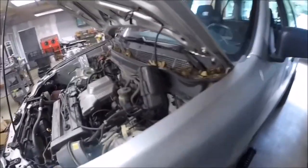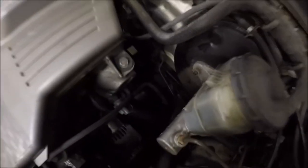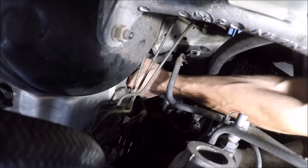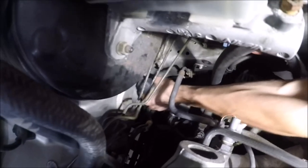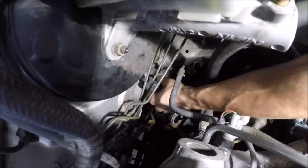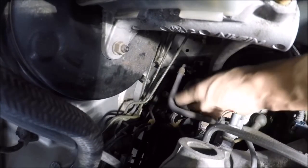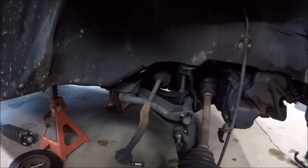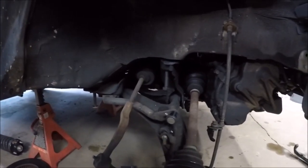Make sure your wheel is straight when you do that so it doesn't make your steering wheel crooked. I'm going to get the bolts out of the steering shaft and I have the steering wheel held with the seat belt so it doesn't spin and mess up your alignment. Now you're going to grab the steering shaft and really just wiggle it back and forth as hard as you possibly can while pushing up at the same time — just got to wiggle it to break some of the rust and crust out of there. And just like that, now that the steering shaft's out of the way, you can continue removing each bolt and replacing it with the longer bolt so the subframe falls down all at once and stays lined up. Then go back, take each bolt out individually, slide your spacer in, and tighten it up.